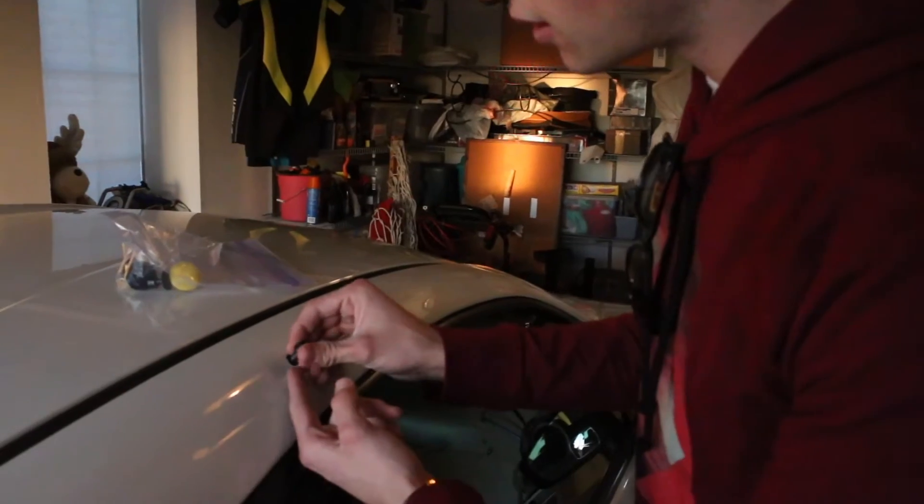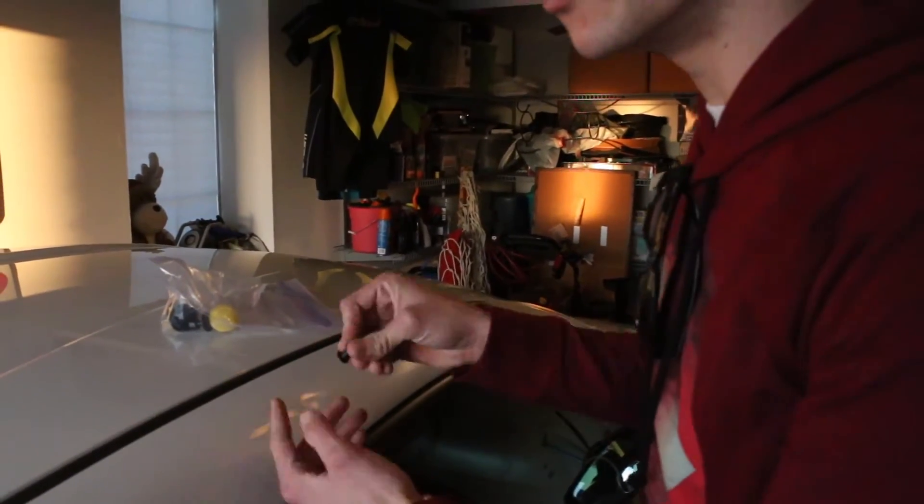If you're gonna put it on here, you press it just lightly. You just put it a little bit on there. That way, there's still a lot of glue between here and the dent. Because if you push it hard, it'll spread the glue out and around and not in between the parts that matter. So once you put the glue on, you're gonna lightly press it on there. And then you're gonna wait for about five minutes.